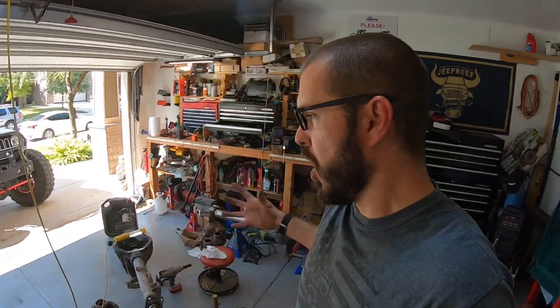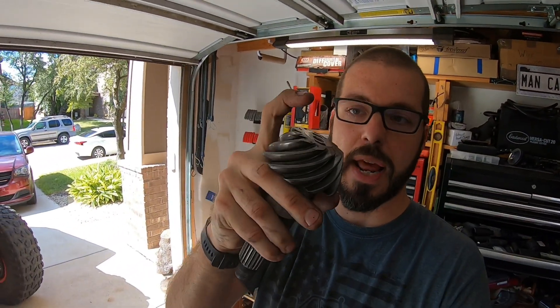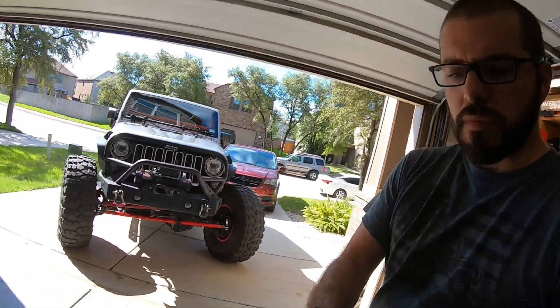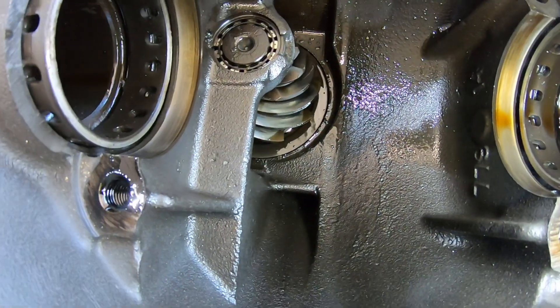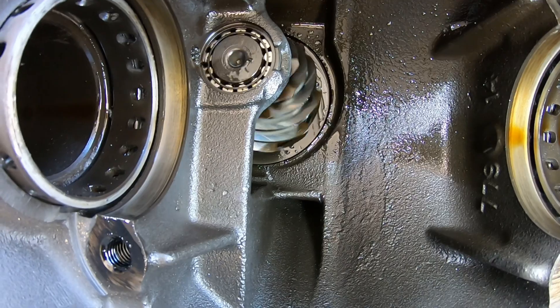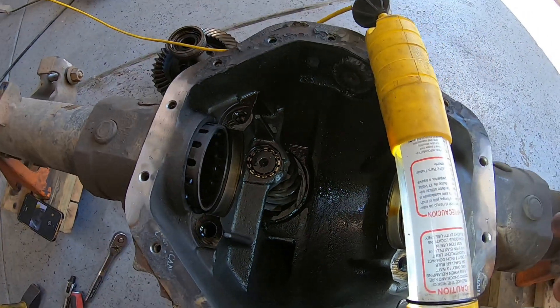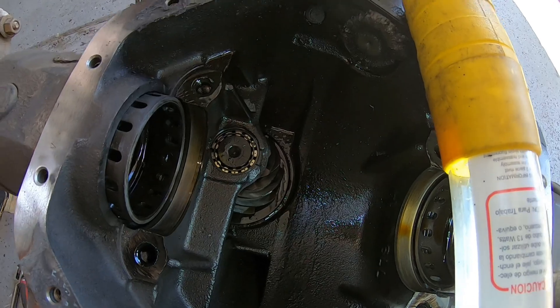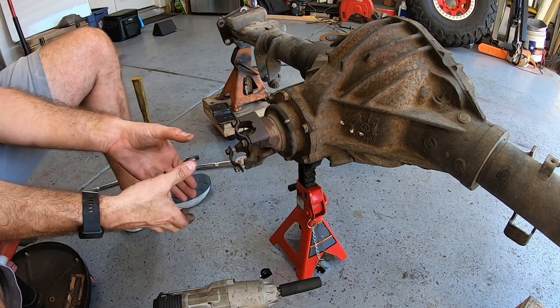We're going to go after the pinion next. If you remember from video two, we talked about how on a normal axle the pinion has a smooth top, but on the 14-bolt there's a bearing on this side as well as the other side. You can see down in here — there's another bearing unlike a lot of other axles, and that supports the pinion on both sides. As that pinion turns, not only is there a bearing up front but there's a bearing on the backside in its own carrier, and that allows it to have no pinion deflection. The pinion is held in its own carrier, so just by removing these bolts it should slide right out.